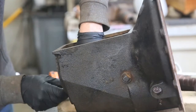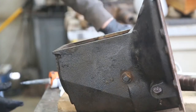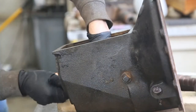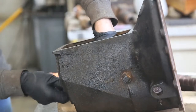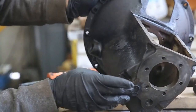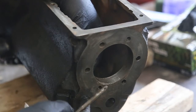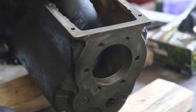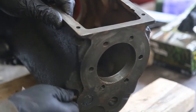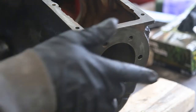Once it goes in, I'm going to come back out and turn it a couple of times just to make sure that silicone is all in there. After you get that done and you're happy with where it is, you've got to line up your little hole. Once your hole is lined up, she's good to go — don't touch it. Now that we've got the reverse gear shaft installed with a little bit of silicone, we've got to make sure that the retaining pin goes through. Now we're established — leave it, don't touch it, move on to the next stage.